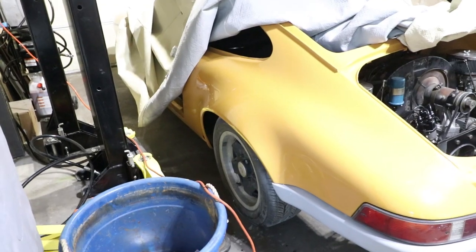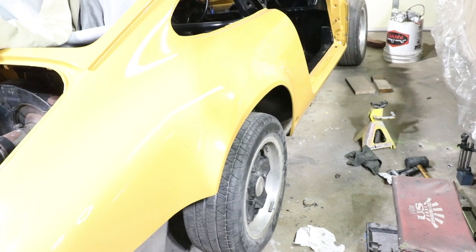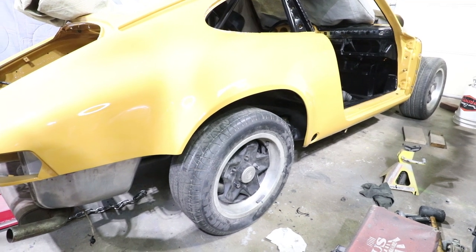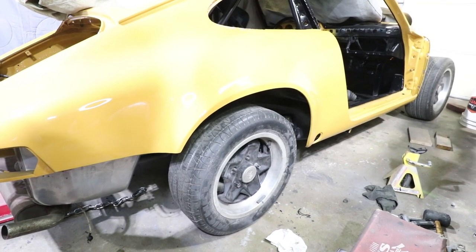It's way too high. It's not really fair to assess the height until both sides are done — this is the side that has no spring, just a solid shock. The side that was just set up is pretty high. I used 2,000 pounds on the calculator — 2,000 pound euro height — and that's the number it gave me with 23mm torsion bars. It'll probably settle down a little bit more if I do the other side, but I'm going to have to take it all apart again and readjust to a smaller angle. I had 31.95 degrees. The camber device I put in has nothing to do with ride height. I need to slot the other side, weld it, get the other torsion bar in, and then reassess the ride height and make a calculated adjustment.